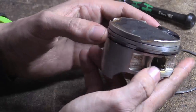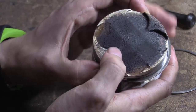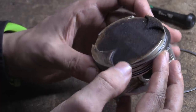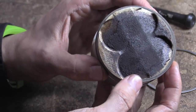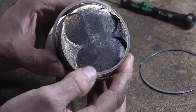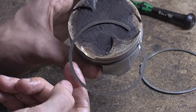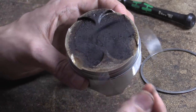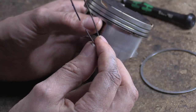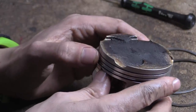So that's the compression ring. Next ring — exactly the same thing. Push there right at the bottom near the ring opening — just to the left-hand side of it. You can obviously do the reverse if left-handed. Push at about ten to eleven o'clock, grab your finger and just go up, then let go. It'll just sit there. Basically just close the ring back up. Then you start at six o'clock, just pushing around, and once the ring is now relaxed, you just rotate it. It'll snag a bit — just one-finger stuff — and then you just lift it out. Nothing — didn't make a noise, didn't scratch anything.